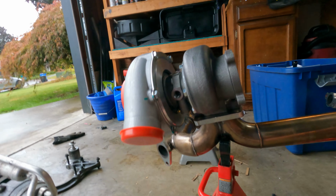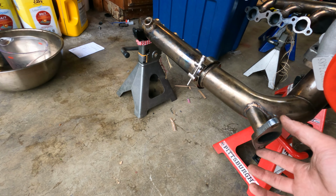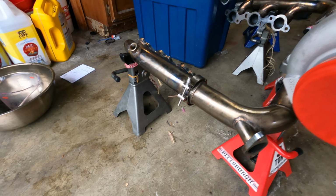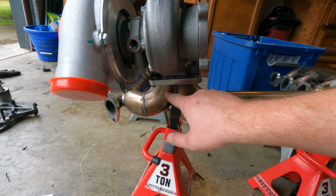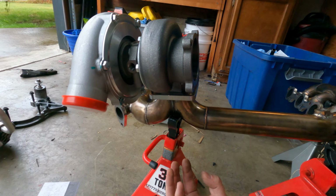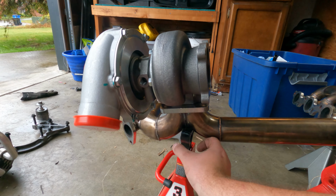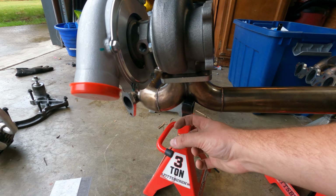And as well as this right here, this is the current bypass valve location, so it's kind of small. I don't know what size this is, it's really, really small. Probably just make a plate for this and then relocate it. Probably right here, we'll need to get a notcher, and we have a 61 mil blow off or bypass valve, or whatever you call it. Forgetting all the terminology for it, but either from the bottom, hole saw up, and then get a piece of exhaust piping down and have a V-band clamp for it. With a V-band, it'll just be easy.